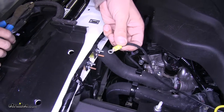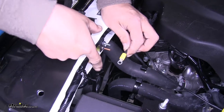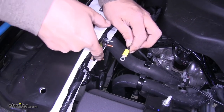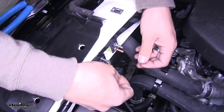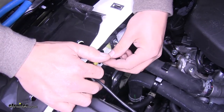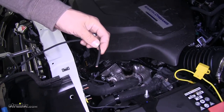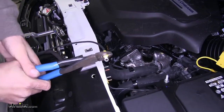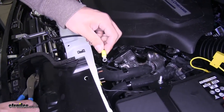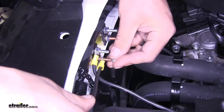Since this is coming back from the seven-way, we're going to be connecting it to the silver post on the 40 amp breaker — it's going to have AUX for auxiliary on the silver post. Loosen the nut, slide our ring terminal over the post, and then loosely reinstall that nut so it won't fall off. Now take that excess black wire, strip back one end, attach another small ring terminal to this end, and connect it to the copper or gold-colored post on that same 40 amp breaker. Slide the terminal over and then replace the nut.